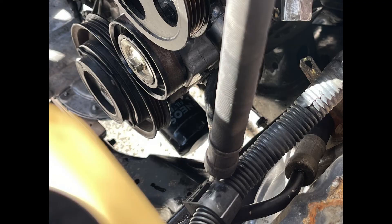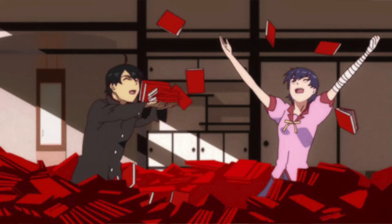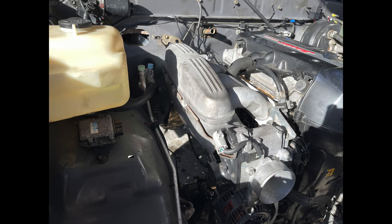What I did remember is that the trans crossmember is not removable, and that's a big problem. Normally when you pull an engine and trans out, you want to try and do it in one shot, and it requires putting everything at an angle and bringing it out. With that crossmember not being removable and the trans sticking over the back of it, even to pull the trans off to do a clutch — all the Tacoma guys will know this — you have to actually unbolt it, twist it back down and then out, and putting it back in is an absolute nightmare.